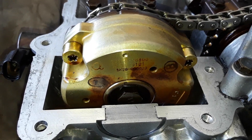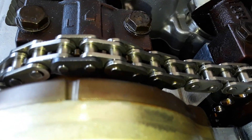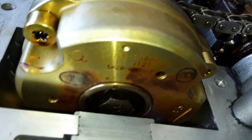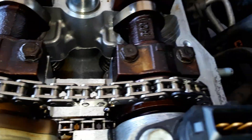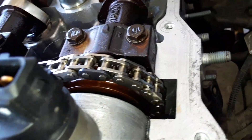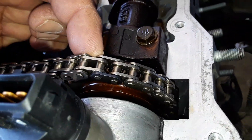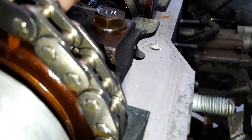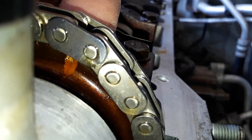Making a video to verify my timing marks. You can see that the black link is lined up with that line and this dot, so that link is in time. And then on this side you can see this black link lined up with this timing mark. Right under there you can see the yellow. So the timing chain is in time.